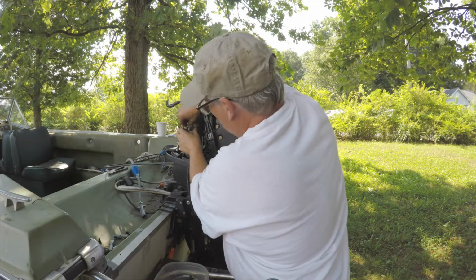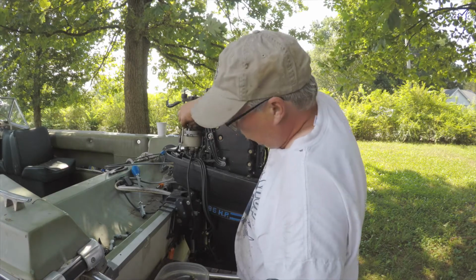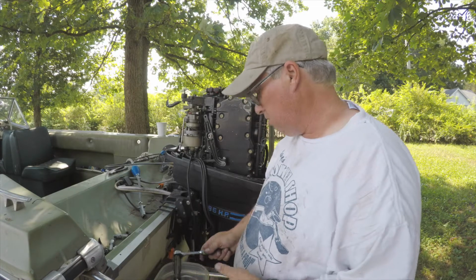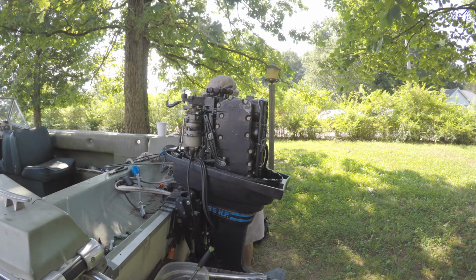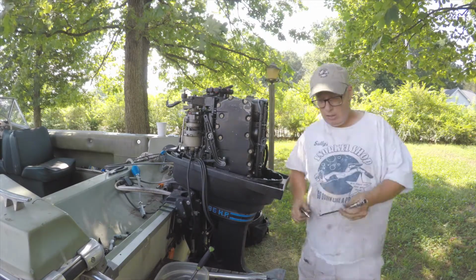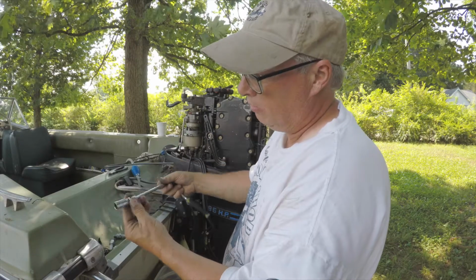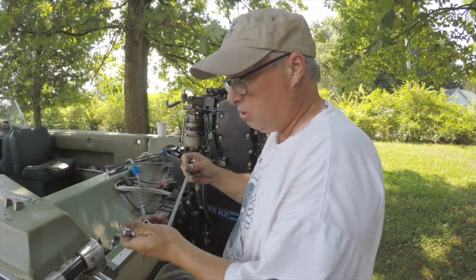But that drops in the distributor, and then there's 4 bolts in the hole that the carburetor's on. And what I did was, they're 7/16, I just used a 1/4 inch. These are the 4 bolts. I just used a 1/4 inch, 7/16. And then I have this elbow. That'll get in there. Some of them, there's a couple of them you can do just straight on.